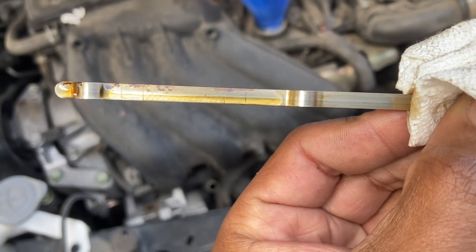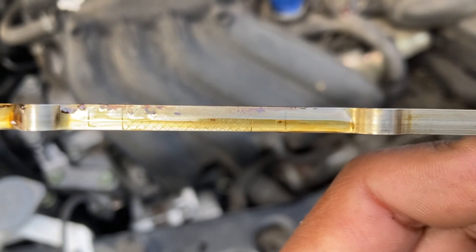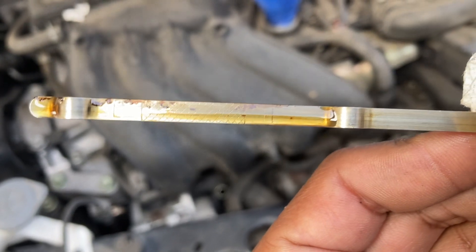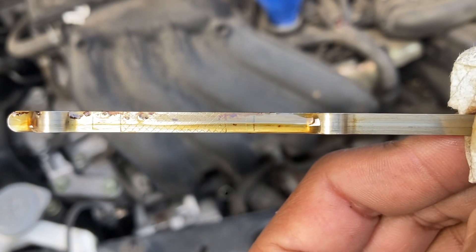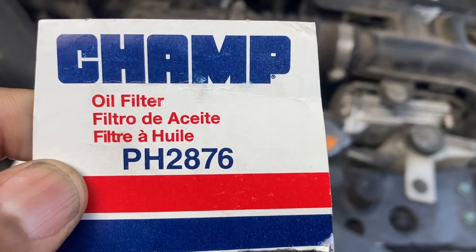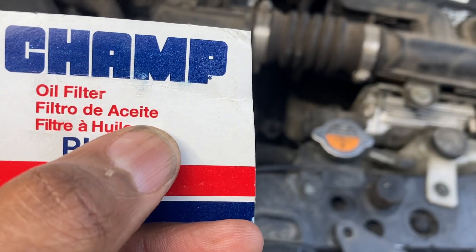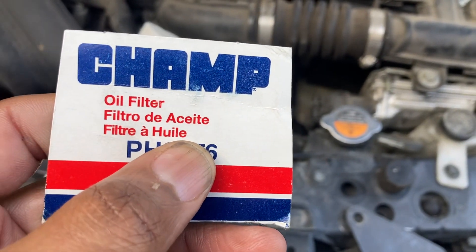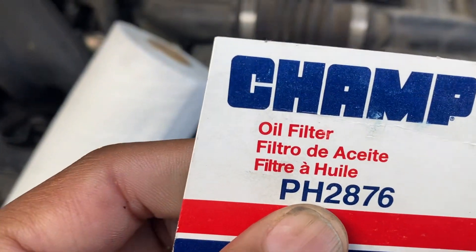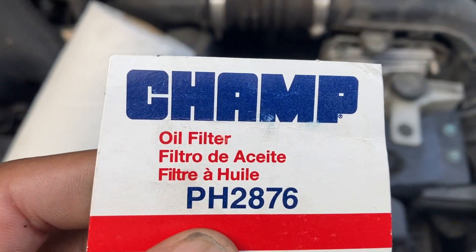So what it said in the computer was 3.9 — I say do 3.5, then check it and top it up. It's just a little bit too much but not so much where it's gonna hurt the car. Since this is my first time doing an oil change on this Nissan Versa, I do 3.5. That's what my daddy used to do — he used to take the little tag off the oil filter box with the number on there, write down the date and how many miles is on the car and when it's gonna be due again, and put it in the glove compartment. You ain't gotta do all that, but if you do, you ain't gonna be guessing next time you get ready to change it. You just reach in the glove compartment and everything you need to know is right there.